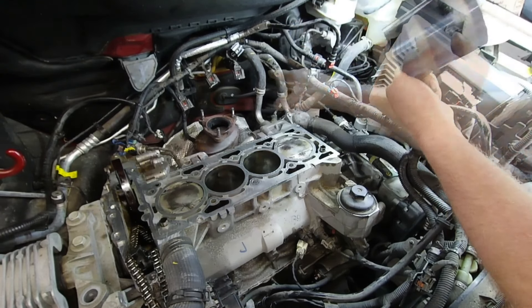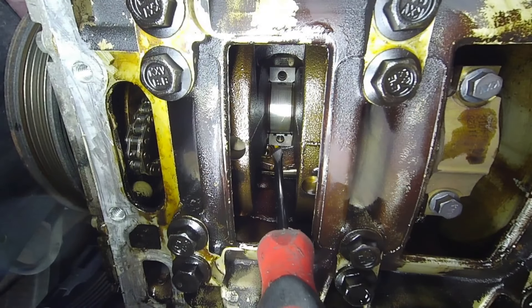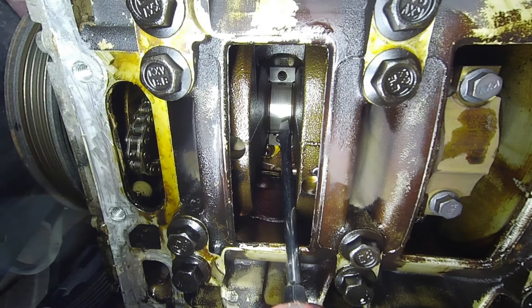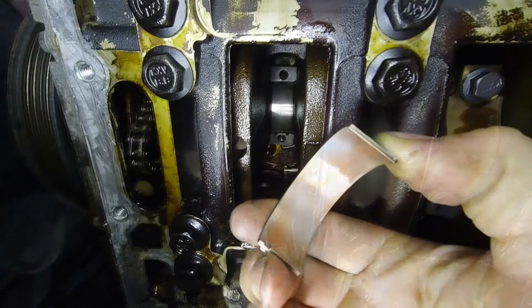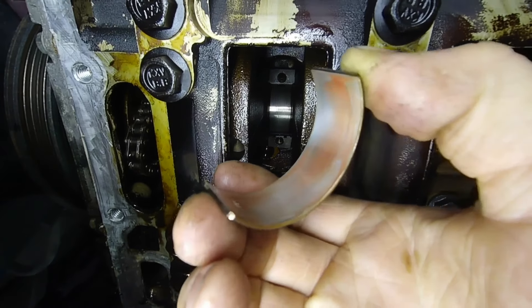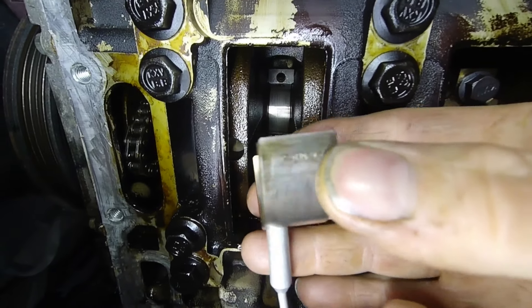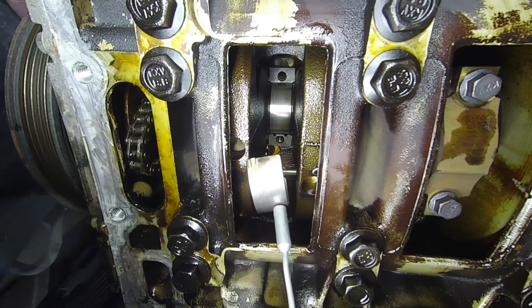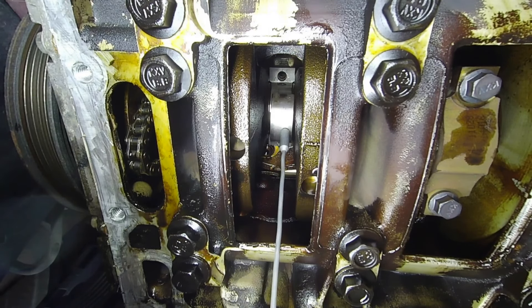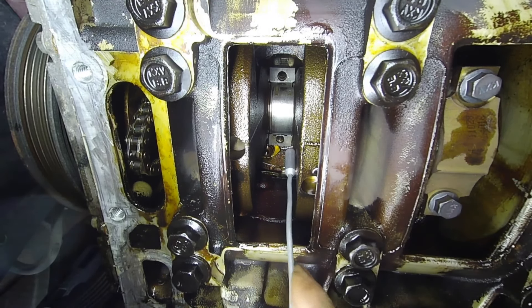Now I have to go underneath and put all the rod caps on. We are under the car now, looking at the rod bearing surface. The connecting rod is loose so I can squeeze the bearing under there — I had to push the piston up just a little to get enough room for the bearing. The bearing has assembly grease on the surface. Bearings are typically magnetic, so you can put the bearing on the end of a magnet to position it. Make sure it's in the right orientation, then rotate it. That grease will hold it against the surface, so push it down to create a vacuum, then pull the magnet right off.